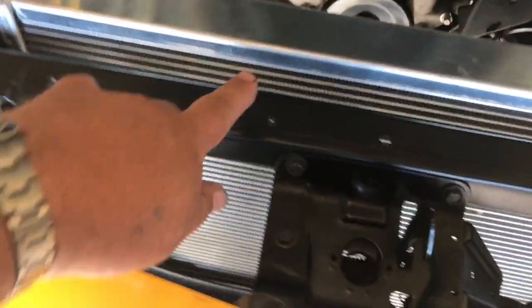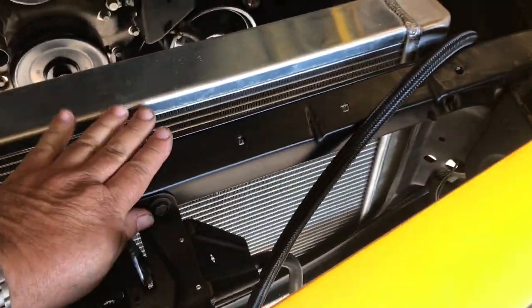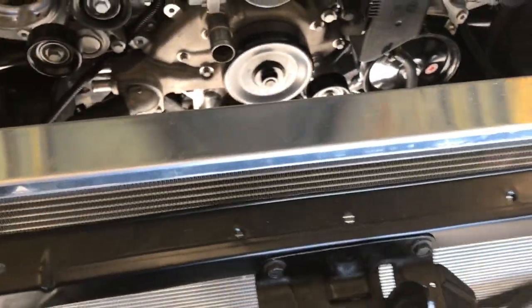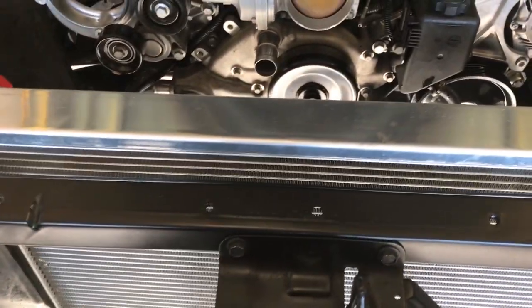Lucky here, back on the project. Here's a recap of what's going on. Cleaned up the engine compartment, got the radiator starting to get the mount. I want to build an upper mount right here. These two bolts go forward, then go over with some aluminum, bend it over, put some rubber in there. Stop it from vibrating, will look kind of cool.